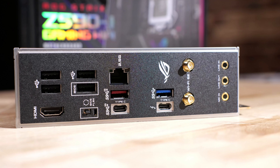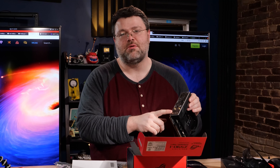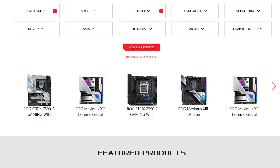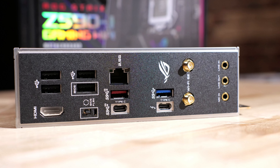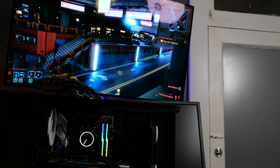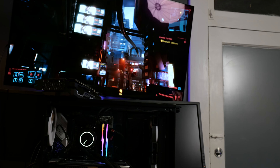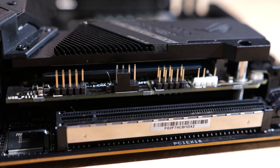The onboard audio has the standard three jacks: mic-in, line-out, and line-in. It's not atypical for an ITX board, but if you want an optical S/PDIF connection you'll need to look at a higher-end SKU from ASUS — this is the Strix Z590-I Gaming Wi-Fi. Below the USB 2.0 ports there's also HDMI from the Intel chipset — HDMI 2.0b — so with my 4K 120 Hz HDR OLED monitor I got 4K 60 Hz. Hopefully driver updates will improve that in the future; check for a pinned comment below.